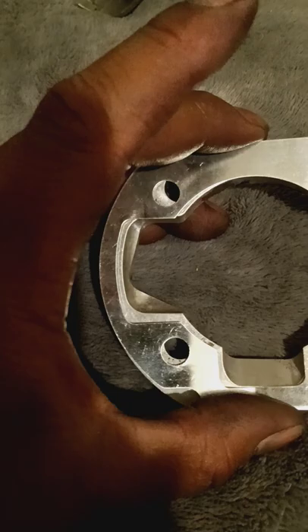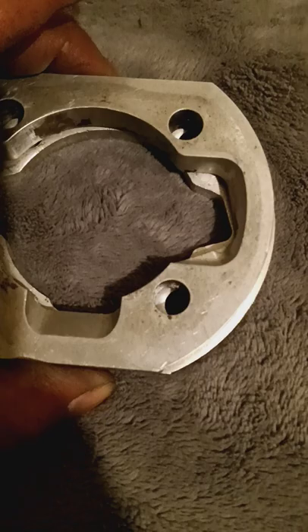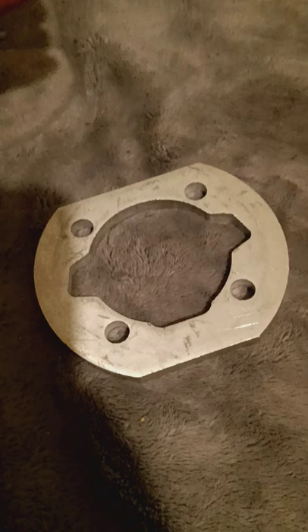Basically that's the same opening right here. Of course this gasket's a little bigger because this is for a sports racing cylinder, but you get the idea of it being pretty close. This is going to give me a rough eyeball, and I'm going to make it go a little bit smaller - where the sharpie line is I'm going to stop before the sharpie line. Same thing with this side - I'm not going to match 100% all the way to that sharpie line just because this is a different size rod and the material is a lot thinner.